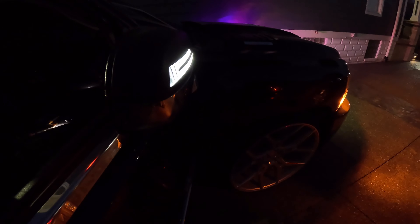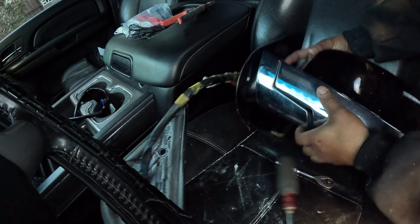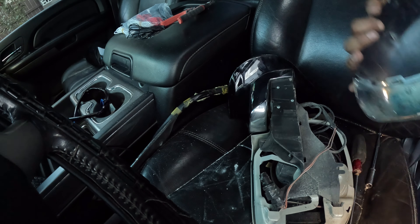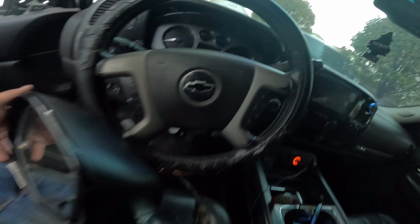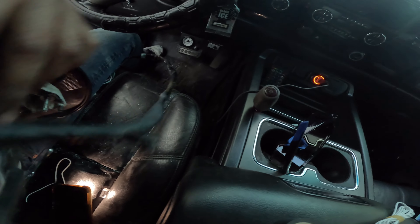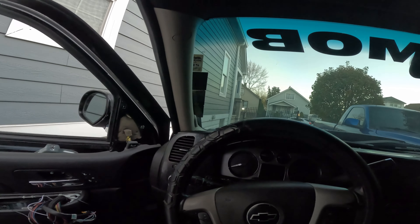This is the final result — you can see it like nothing was ever there. Let me test it — when I unlock it, it lights up. I got everything bolted on. For the passenger side you do the same exact thing: take out the lower panels, remove all the screws on both the mirror and the panel, then start prying it open just like the other side. The wiring is slightly different but the process is the same. I got the mirror all together, tucked everything back in, put the mirror back, and from there we start wiring.